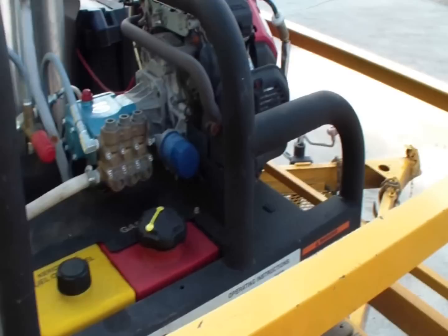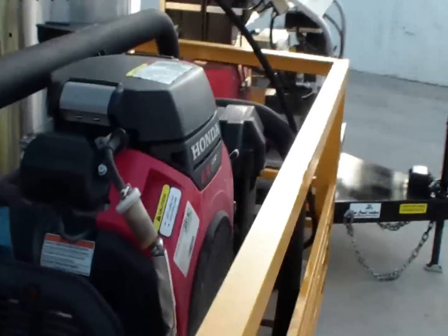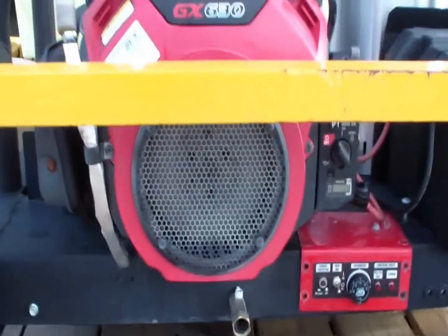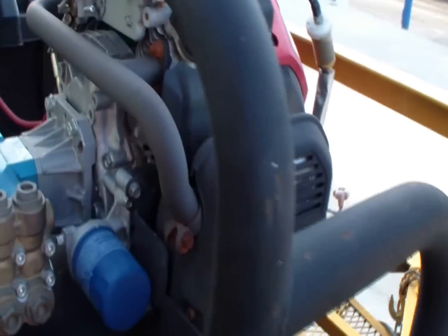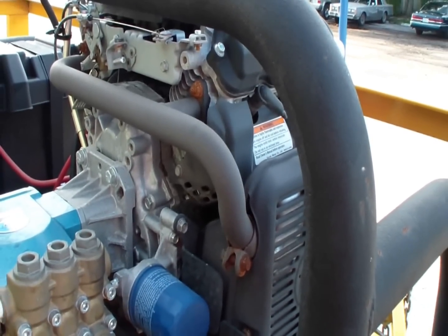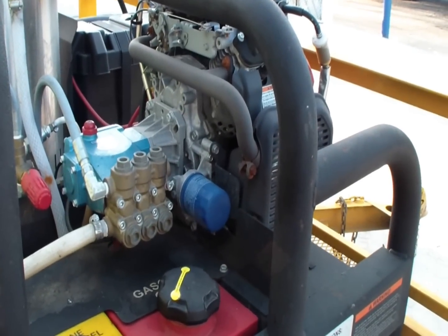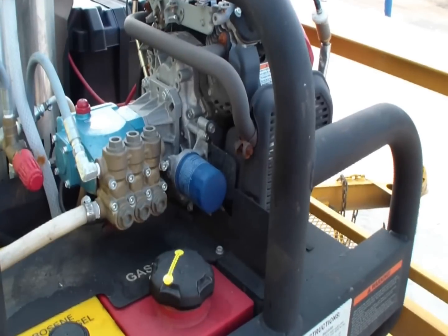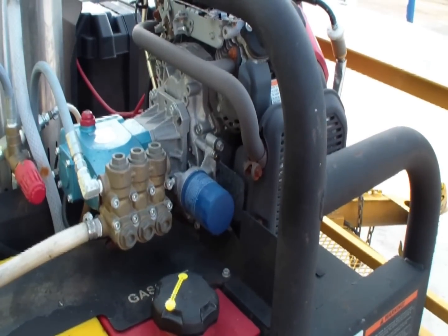The main problem is, with an air-cooled engine, all the air comes in from the front of the engine. Right here on the flywheel is a large fan that actually sucks air into the engine to help cool it. It blows across the cylinder head, to the back of the engine, past the exhaust system. Typically the engine can run at 350 and up to 400 degrees. All that heat can transfer right to the pump, and the metal-to-metal contact with the shaft of the engine is inside the pump.